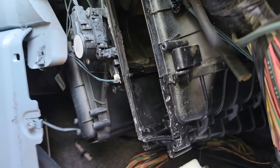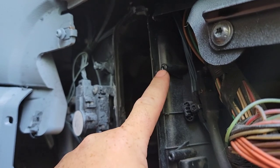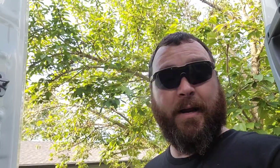There's a video before this where I talk about that, but this video is me putting it in. Real quick - the evaporator coil should come with a cover. They literally make these housings to accept the replacement cover - that's what these screw holes are for. But the replacement evaporator coil I bought did not come with the cover, which makes no sense. I had to order it again and it cost me 41 bucks. I was able to pick it up at a local Freightliner dealer.